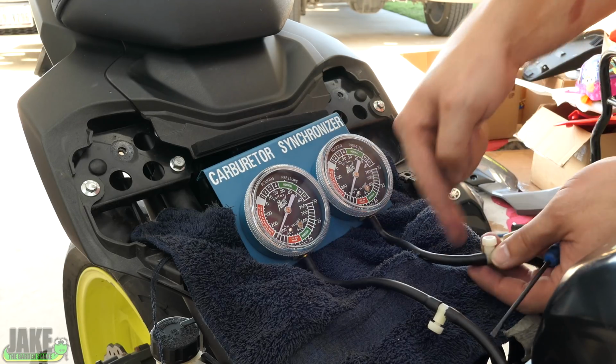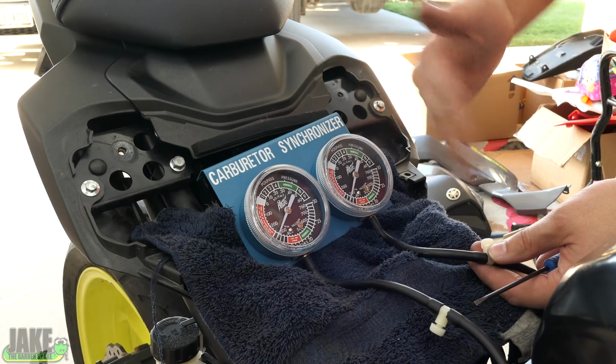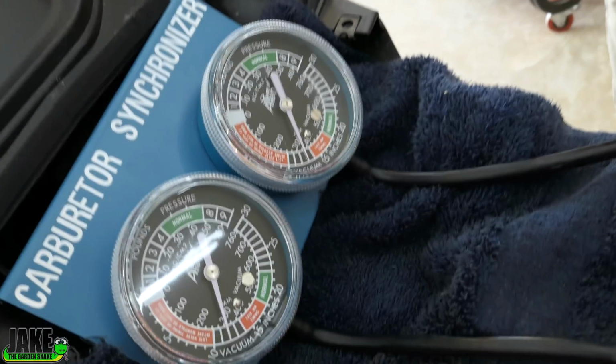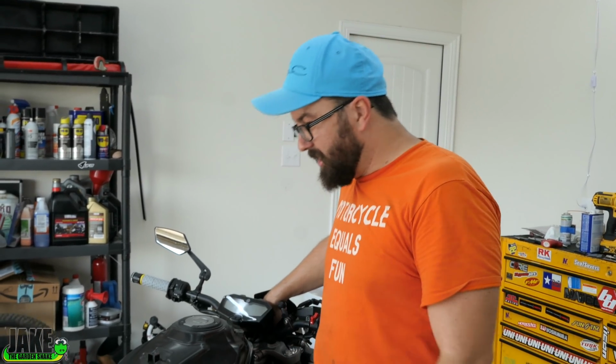It's not so important that these are perfectly tuned to each other. It's not like this is changing the tuning of the gauges. This is just changing how much it fluxes in each direction. We've hit temperature now. I already see a slight variance in the gauges. I'm gonna call that good. Hook that vacuum thing back up and let's see how it runs then.